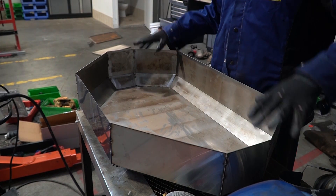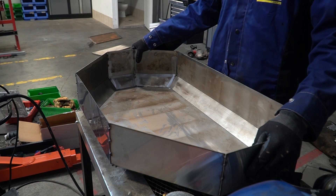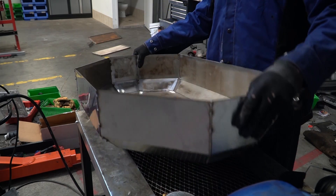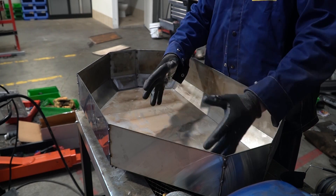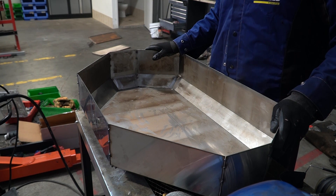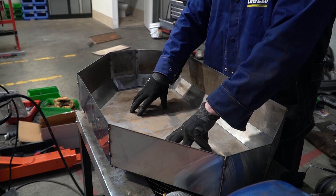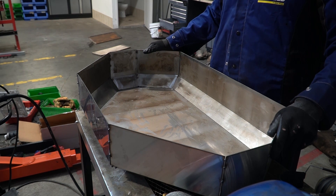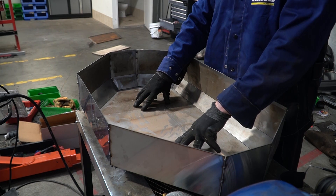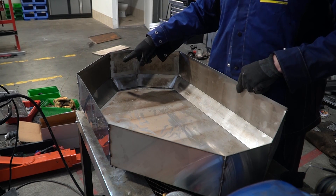Now the reason I'm making this in two halves is because there's stuff that I have to put in here. When a fuel tank is sloshing around with 100 litres of fuel, that's a lot of weight moving around. Cut that down to half a tank of fuel and you've got a lot of mass wobbling around. The purpose of baffles is to divide the tank and limit the amount of fuel that can move from one side to the other in a short amount of time. I'm going to put two of these in to divide the tank roughly into thirds and provide me with enough space to put my fuel pumps in.